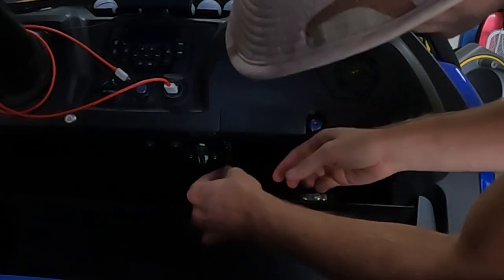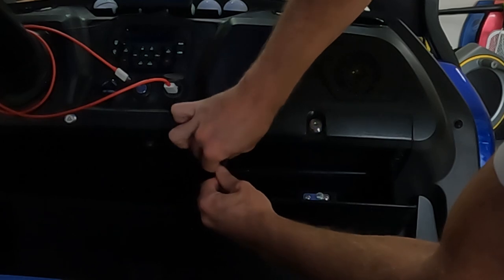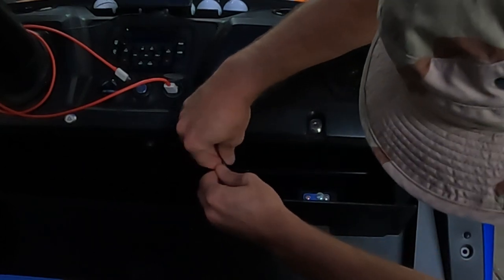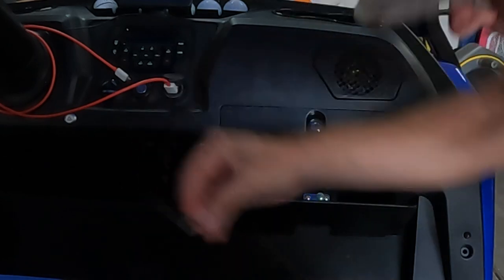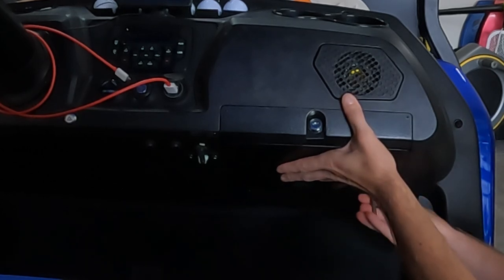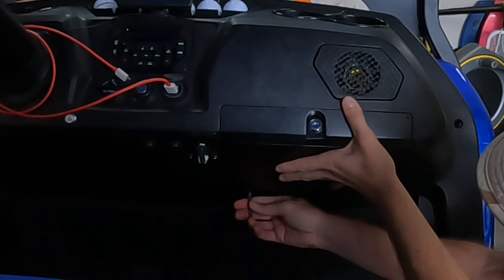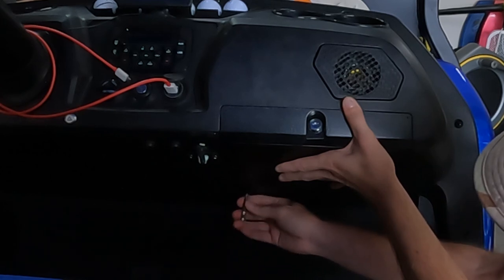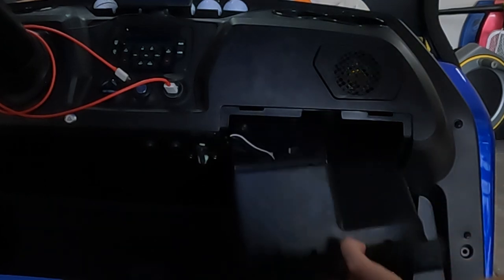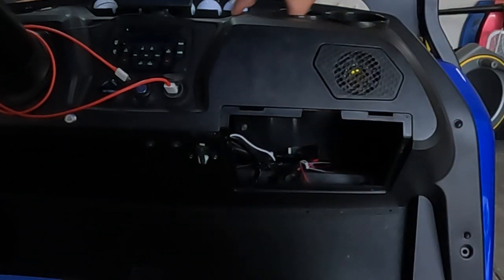And there's a couple more on the bottom. There's the other one with the little metal piece. At this point you can go ahead and close it — it won't stay shut because the magnets are gone — and pull out these two screws at the very bottom. With that, the glove box kind of slides out and now you've got great access in the room here. These little cup holders just pop right on out.